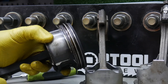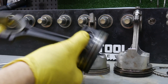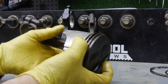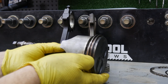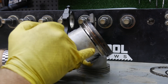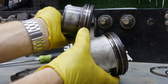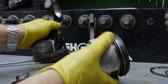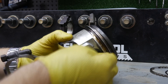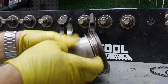What's the problem and what causes this? It's not necessarily bad oil or lack of oil changes — though that can contribute. Let's look at this old conventional small block Chevy 350, made from 1955 into the 1990s. You see that window there in the ring land? That is an oil drain-back. As the oil ring scavenges that oil, it captures it in the ring land and drains it back into the crankcase through that huge window — there's one here and one over here.